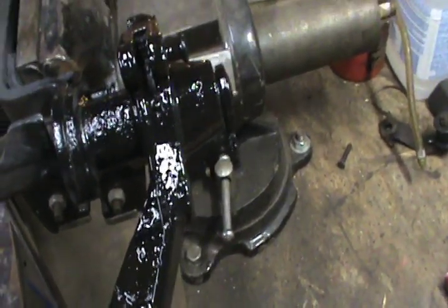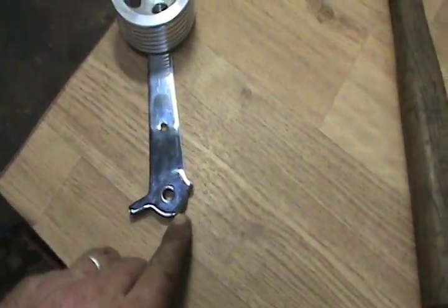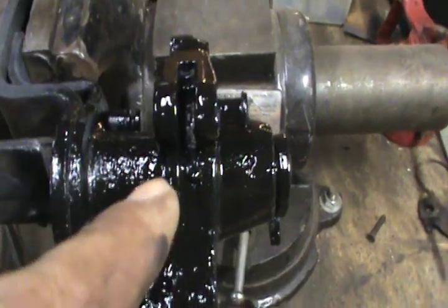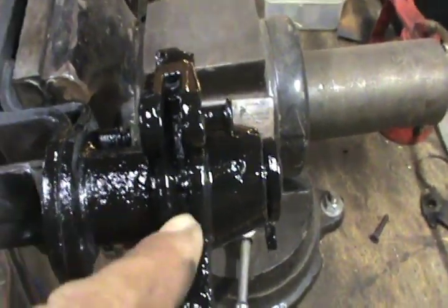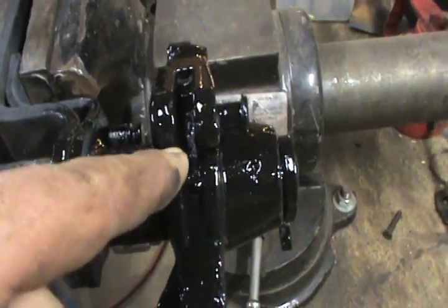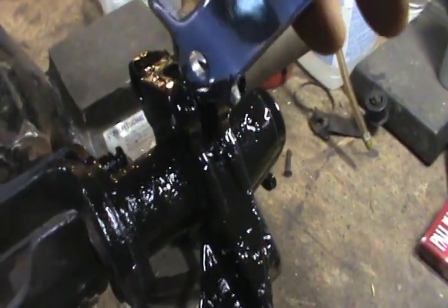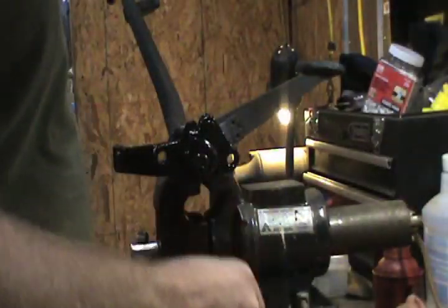I just want to put just something on this aluminum to keep it from oxidizing any more than it already was. What I really want to show you here — when you put one of these pedals on, on this bottom edge right here, that rides in this groove here. If you have your pedal sticking on your Volkswagen and your spring tension and everything is good, look down in here. You'll get sand, dirt, just crud that'll build up in that, and it will eventually get to where it doesn't want to move freely.